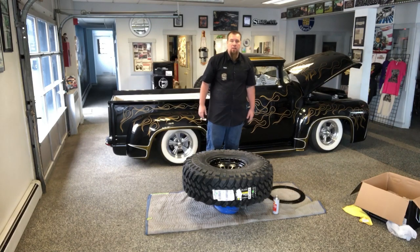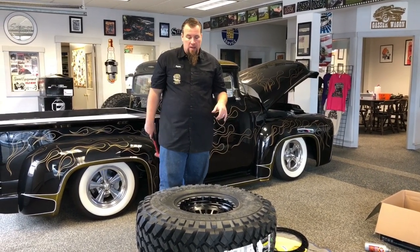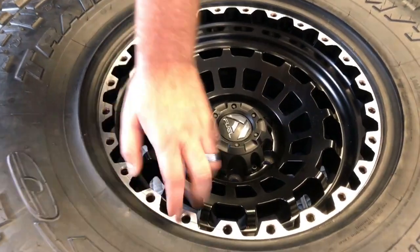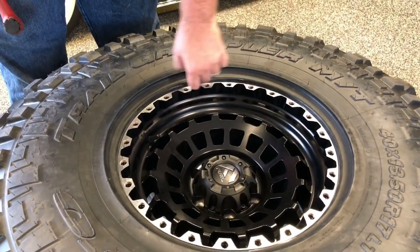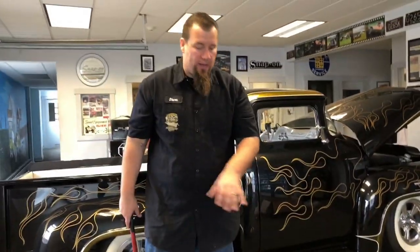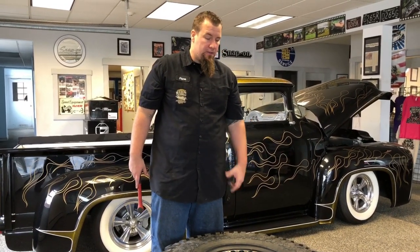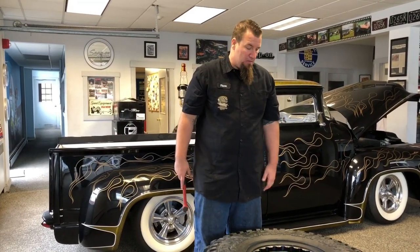You've got a nice little platform basically holding the wheel and tire. Now that we have the wheel and tire on the bucket and everything lined up, you need to make sure that the wheel is indexed correctly and the actual tire is indexed correctly around the wheel. On these wheels there's a little inset that sits around, and you want to make sure that this tire is nice and evenly gapped around here. If it's not, then you'll have a leak. Make sure you have no extra casting flash or anything like that around the wheel. If the tire isn't seated, sometimes use a rubber mallet to knock it around. It shouldn't take too much effort, but obviously the bigger the tires, the thicker the sidewall, the tougher time you're going to have.